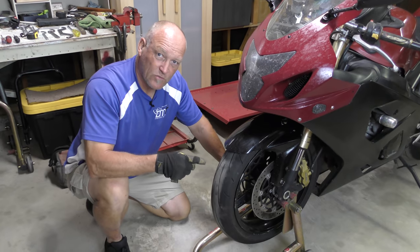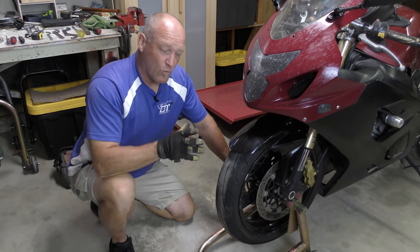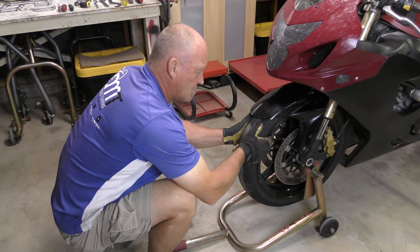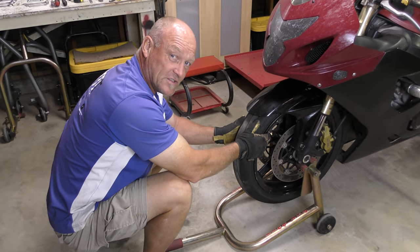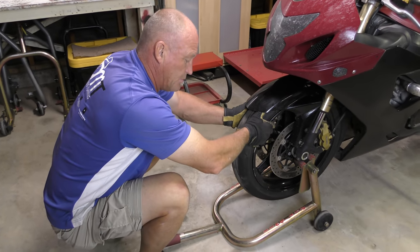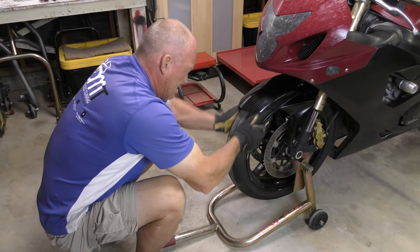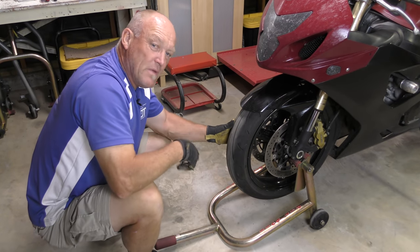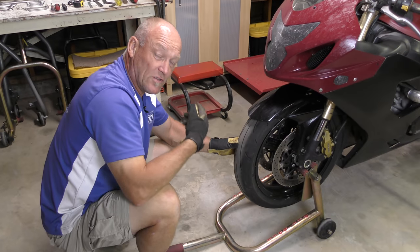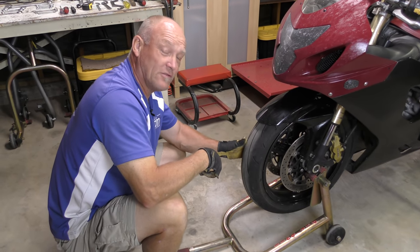So we're going to pull this wheel out, put the other wheels in, and see what differences we have, doing exactly the same front wheel mounting procedure, so that what we're doing on the front end here is correct every single time and consistent. Therefore the test is fair. In checking the wheel, we've got to be as consistent as possible in testing spin. I'm going to grab it with two hands, thumbs under the fender, and then basically pull until my elbows hit my knees. We're getting probably maybe 30% of a turn to maybe a quarter of a turn, really not much more than a third of a revolution. We'll do the same pull test on each wheel so that I'm not cheating, because after all, this is the internet.